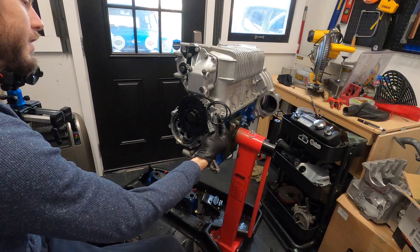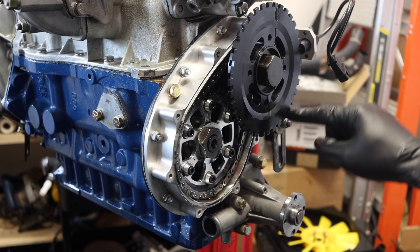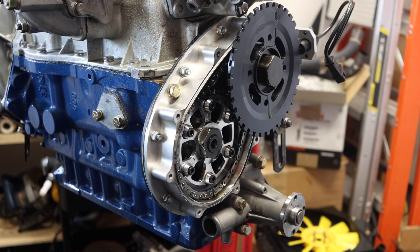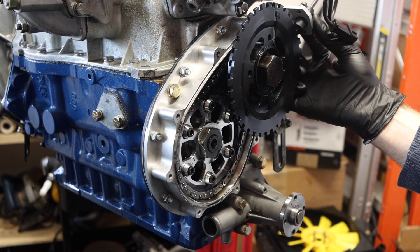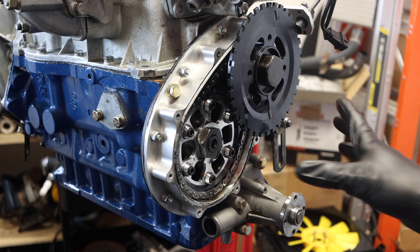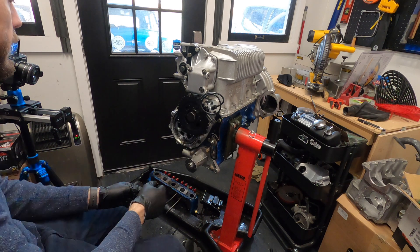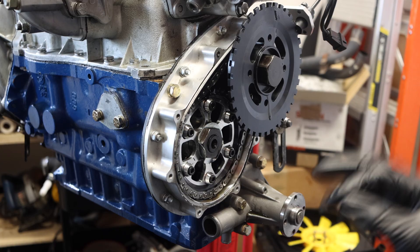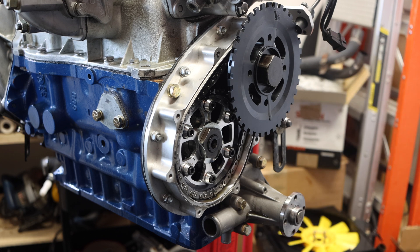You might find something interesting here — this is a crank position sensor. The way it works is it reads the teeth of this management wheel, this pulley with teeth on it. What we'll do is knock one of these teeth out, and the sensor will see when that tooth is missing and be able to measure crank position from that. I'll get into that in a later episode, but for right now we need to remove this pulley so we can get into the duplex timing chain and gears.